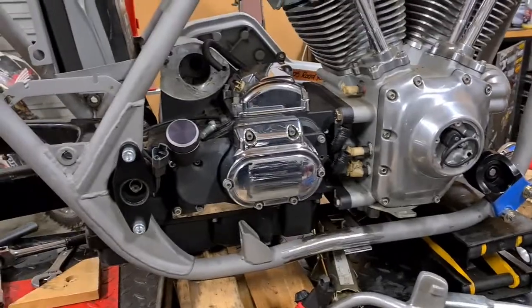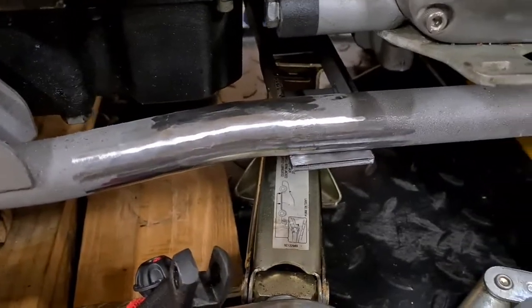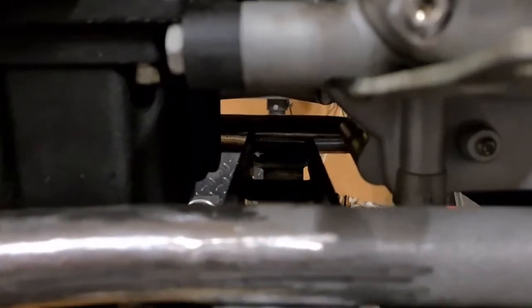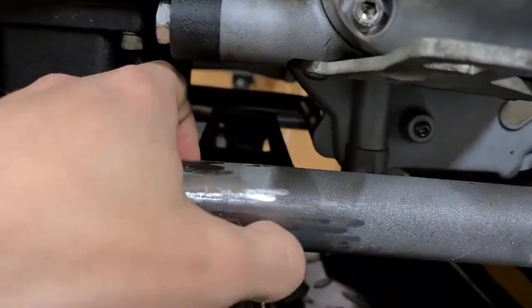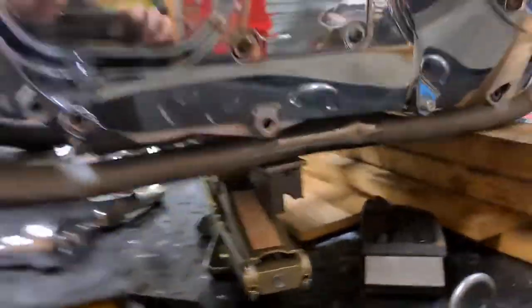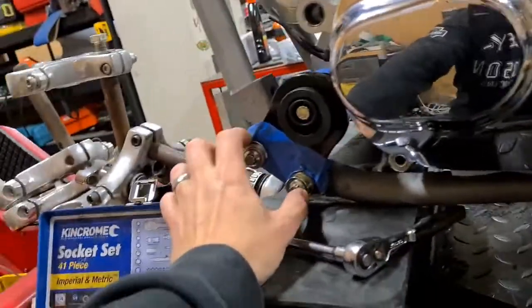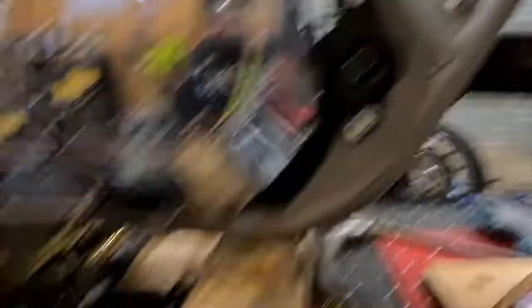For this conversion I'm using the Ramjet FXR Twin Cam conversion kit - super nice bit of gear and I'm real happy with it so far. This is the Dyna-style cross member they provide. Really good fitment - I'll trim that little overhang to make it cleaner, but inside is super nice, all beveled. It lets you run a full Dyna side stand, which can be another issue with Twin Cam FXRs. If you don't run a cross member, you're either going to have to run it off the front in that weird style or do modifications off the frame or run it off your pivot bolts, which I don't like.